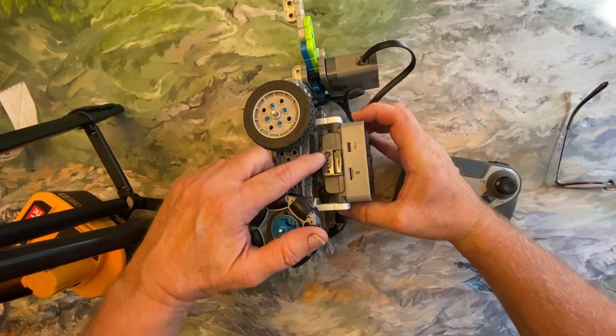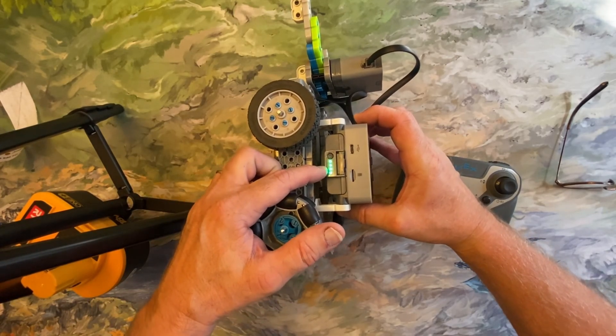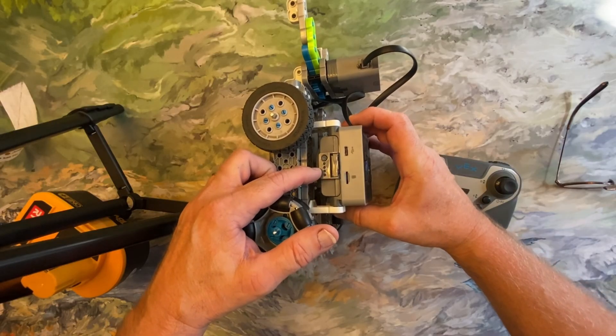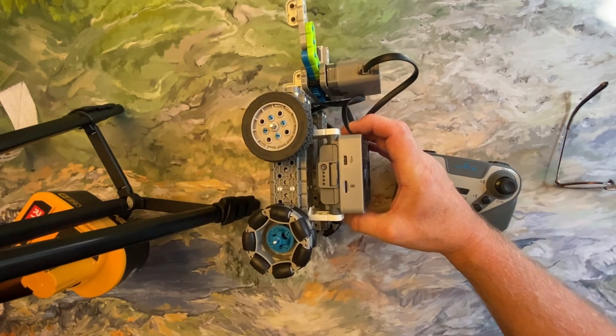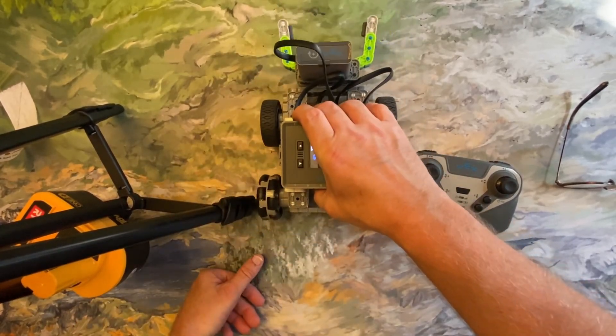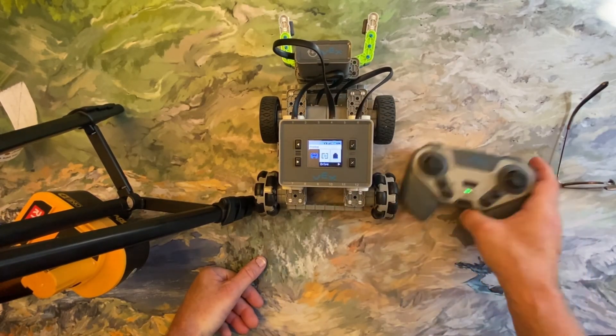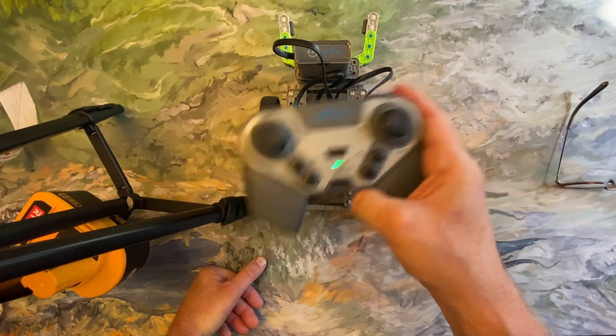To check your battery, just look at the battery indicator. If you get two LED lights or below, change that battery out and see if that fixes it. Sometimes it does. Anything two or below, you need to switch out the battery. But close to 100% of the time, calibrating the controller is what you need to do.